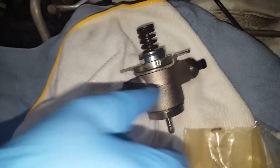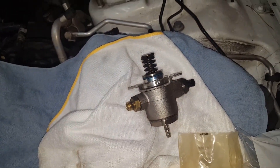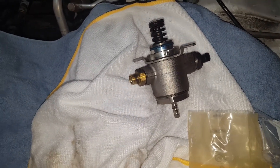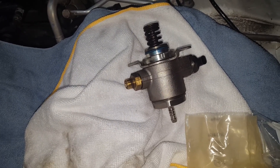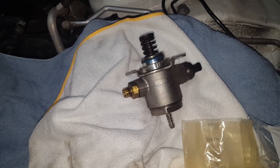That's it for the cam follower inspection. Now we're gonna put this pump back — I'm just gonna wipe the outside a little bit and put it right back in the housing. We'll make sure we don't over-tighten it; we'll follow the proper torque spec for it. Then we'll put it back and start the car up. Thanks for watching guys!